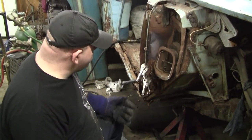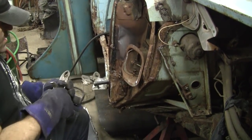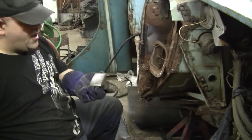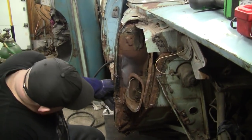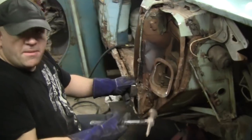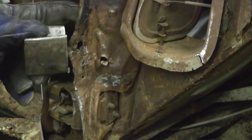Okay, what's next? Now we're going to bend the lip straight, as you can see here. The purpose of bending this lip straight is so we can try to flatten the metal behind it. Now what we're going to do is use two of my favorite tools — a hammer, and this is an oblong dolly. As you can see I have two, nice and textured. What these are going to achieve is to keep the metal flat on a beaten-back path, to try to straighten out what little bit of metal is left. Because on this rail, we want this rail as straight as possible. The only way to achieve this is to beat it straight and then bend it back to its curvature.